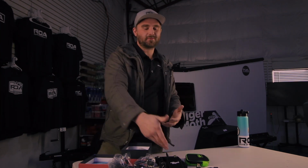So that way you can be aware of your tires without having to watch them all the time, and be alerted, so that you can stop and take care of whatever is going on. Temperature wise, maybe a caliper is locked up and you don't notice because your truck is powerful and just pulling the trailer along, and you don't even know that it's happening. But this will alert you, so then you think, oh crap, I'm overheating, I should stop.